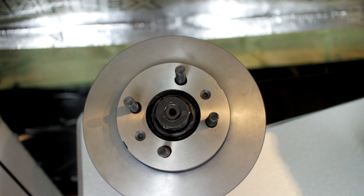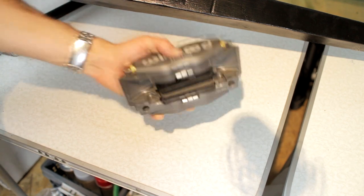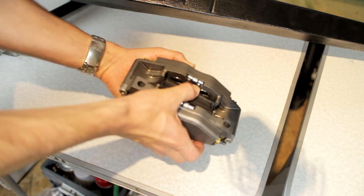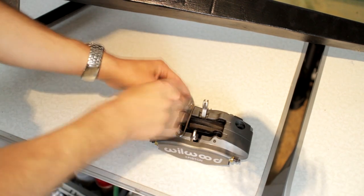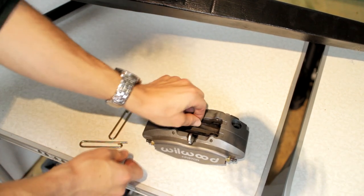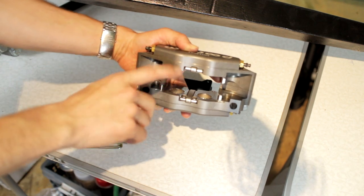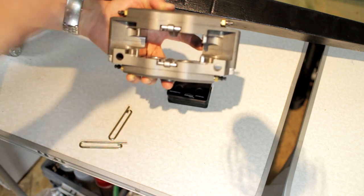Now it's time to install the caliper, but first let's look at why this caliper is such a great caliper for our cars. The Wilwood power light caliper is made of forged aluminum — it's very light, about a kilogram. These are available in different piston sizes. This one has the smallest pistons — it's a four piston caliper. As you can see on the inside, they have quick release brake pads with just two pins to remove. You can see four stainless steel pistons. The only downside to the calipers is they don't have dust shields, so they will require a bit of maintenance. However, these cars require a bit of maintenance anyway, so that's not really a big deal.